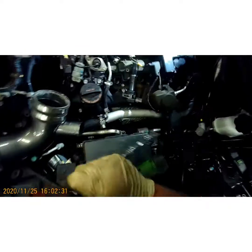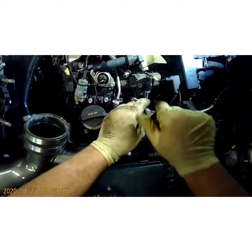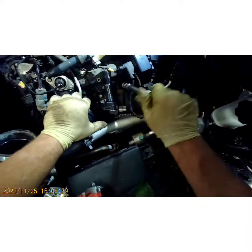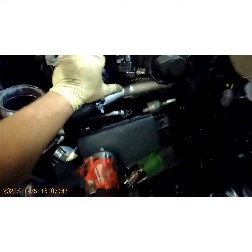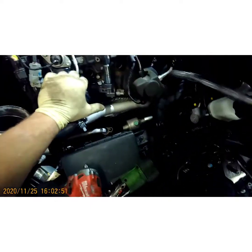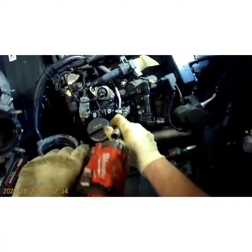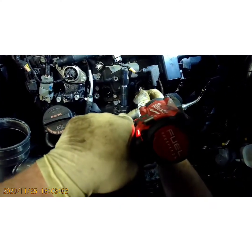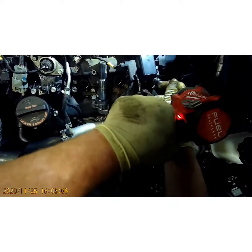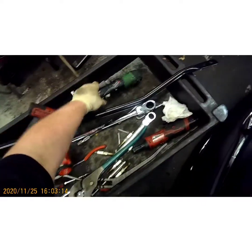I'm going to go ahead and finish up the side that you don't have to have the intake off. Make sure you start these by hand, just a few threads. And those of y'all that don't feel comfortable, do not use a gun if you don't know how to control it. Because these guns have a variable trigger on them, I can control the torque. We're just gonna run them down gently. Take my ratchet and give them a nice final little snug.